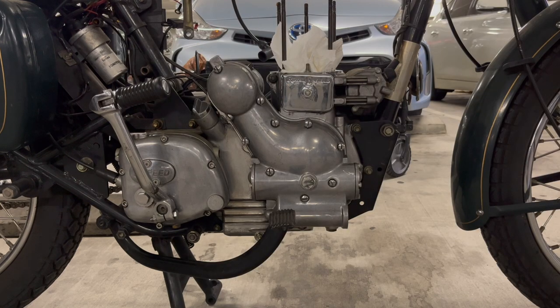Anyway, that's the new plan. But today I'm opening the timing cover, replacing the oil pumps and spindle, removing the timing gears, and just getting the right side ready to drop the crankcase. I'll also show you how to lap the oil pumps so they seal perfectly within the case, and I'll install the new oil filter assembly.